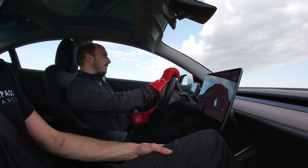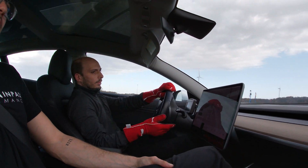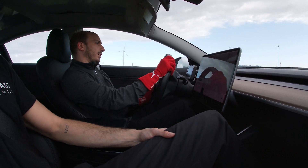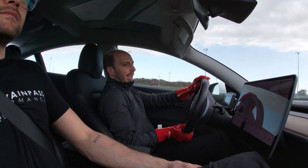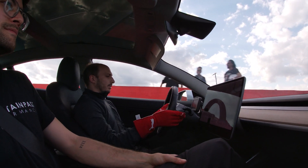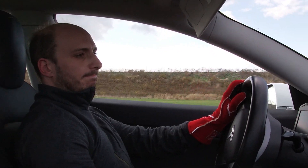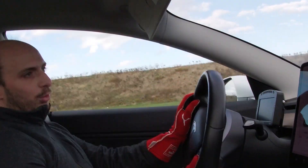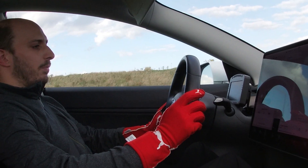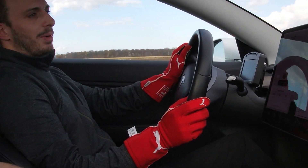I think the air conditioning compressor is running — yep, it's full bore now. So the air conditioning compressor came on, which is going to totally skew our results because it was working to where it never even came on before. Now it's working to pull down that stator motor temperature of 150 degrees Celsius. We crossed the line and unfortunately our test is a bit skewed because the air conditioning compressor ran the entire time this second run, whereas the compressor didn't run at all last time. So the heat we were able to shed with the oil cooler is now being shed by the air conditioning system.